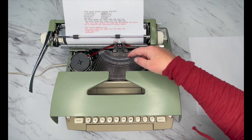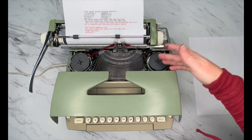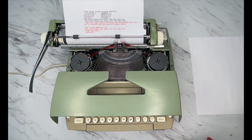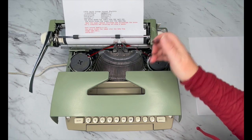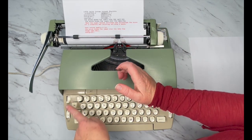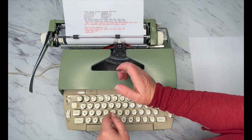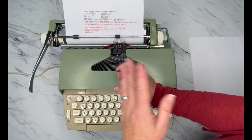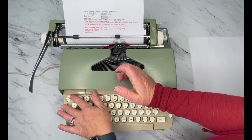When you get to the end of the spool, it's not the end of the ink in the ribbon — you need to reverse the direction. Some ribbons you can get have an auto-reverse feature. If you need to manually reverse, it's right here — it says 'rib rev,' that means ribbon reversal. You just flip that up and that reverses the direction. You can reverse that many, many times before you use up all the ink in your ribbon.